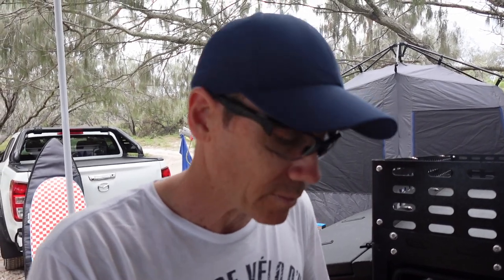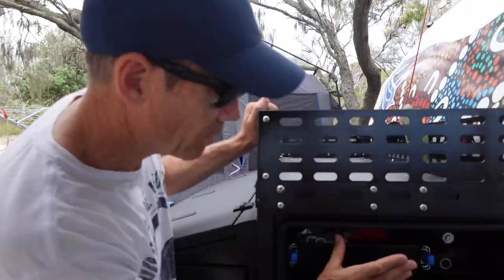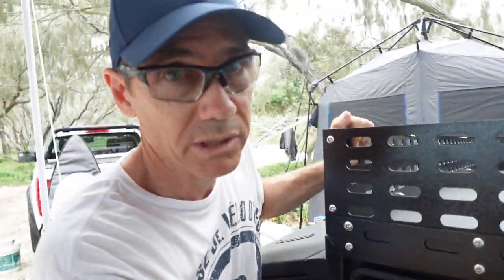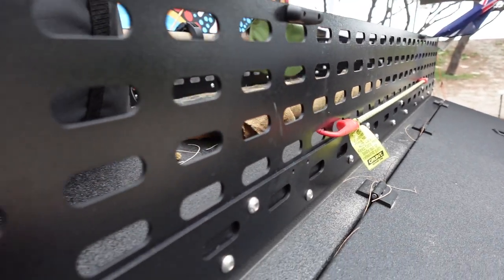I've made something to secure the Weber barbecue so that on rough terrain it stays exactly where you want. I've secured the Weber to the base plate using stainless steel fixings, drilled through the stainless steel and base plate, put nutserts in with some little screws tying it down — no ratchet straps, nothing that can come loose. There's heaps of storage, a slide for all my Weber accessories, and this set goes right through the other side for tent poles, fishing poles, whatever. On top I've opted for the extra wood box to keep all my firewood, plus a shovel holder and room for max tracks.